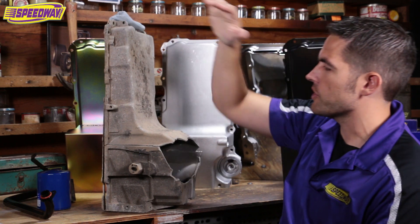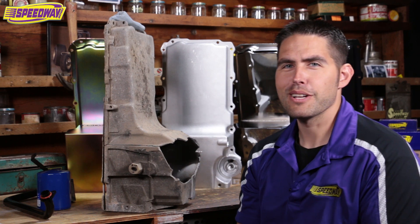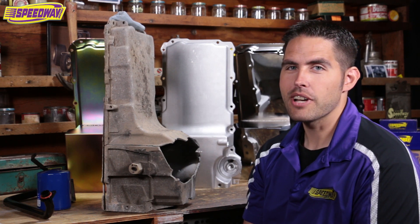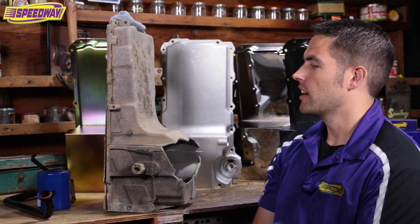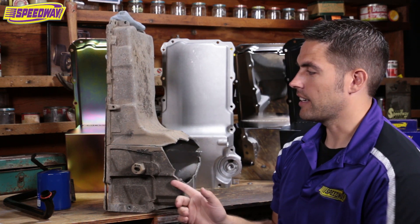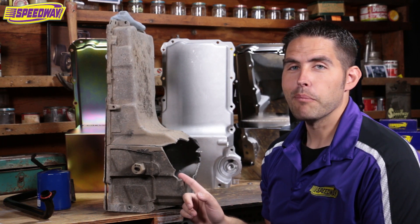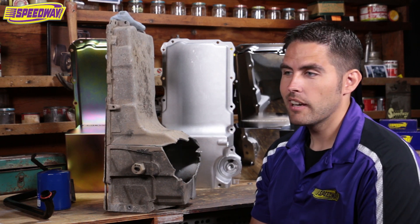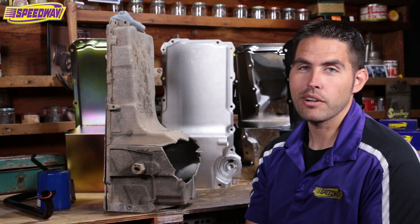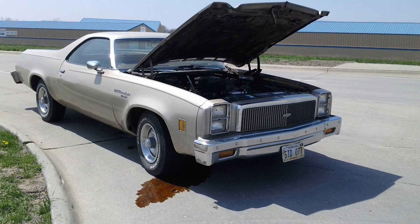As much as I wanted to keep the project cheap and use the stock oil pan off the 5.3, it probably would have been a lot smarter to use one that was a lot shallower. This thing measures in at almost eight and a half inches deep, hanging about two to three inches below my cross member. I knew I had to take it easy on bumps and curbs — and then I did a brain fart going over railroad tracks. So I would suggest getting a proper pan. Let me show you what we have.